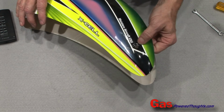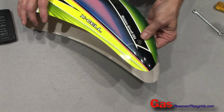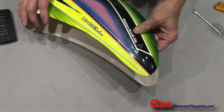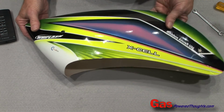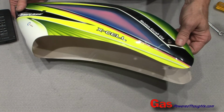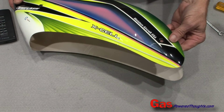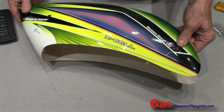Now you're going to want to do the exact same process with the rear holes. There's recesses in the canopy. You should be able to mark the center and drill it, but I'm going to show you a process to absolutely ensure it's correct. These canopies are fiberglass, they're mass produced, sometimes they shrink, they're not all absolutely identical. So I'm going to show you a way to make sure that these rear holes line up properly, and when you drill a hole, everything will fit without putting stress on the canopy, which would cause it to crack more easily later.